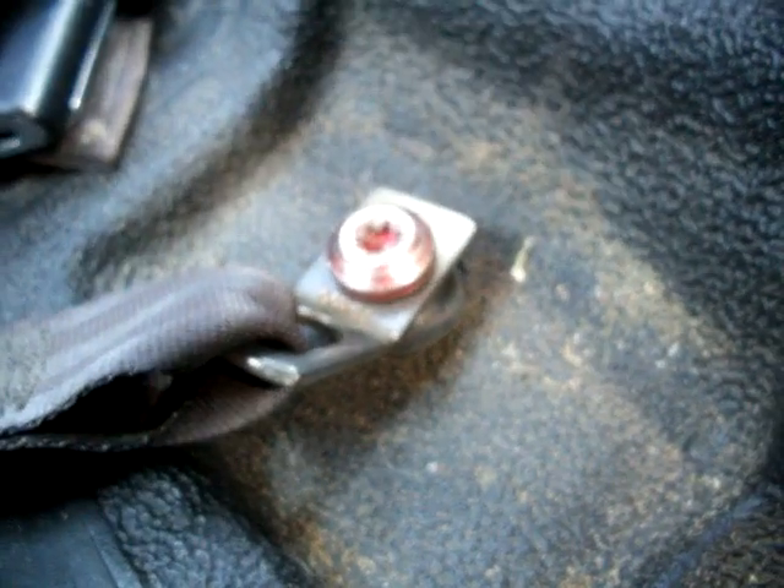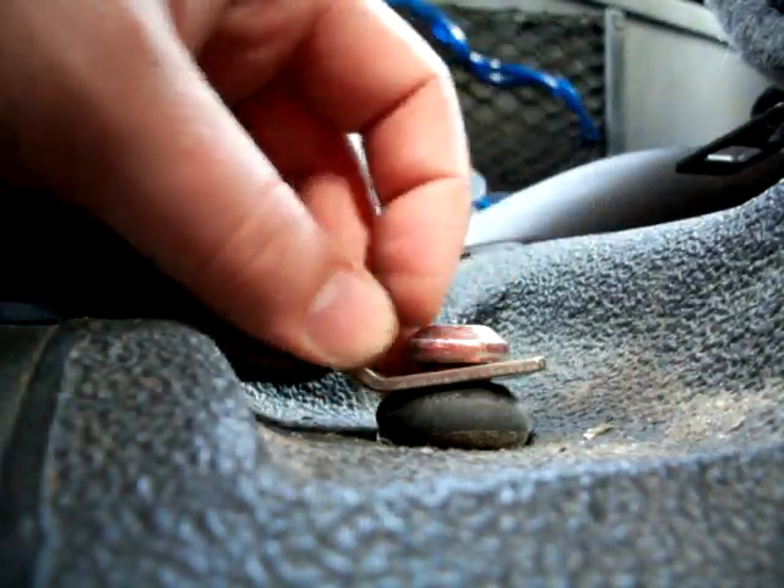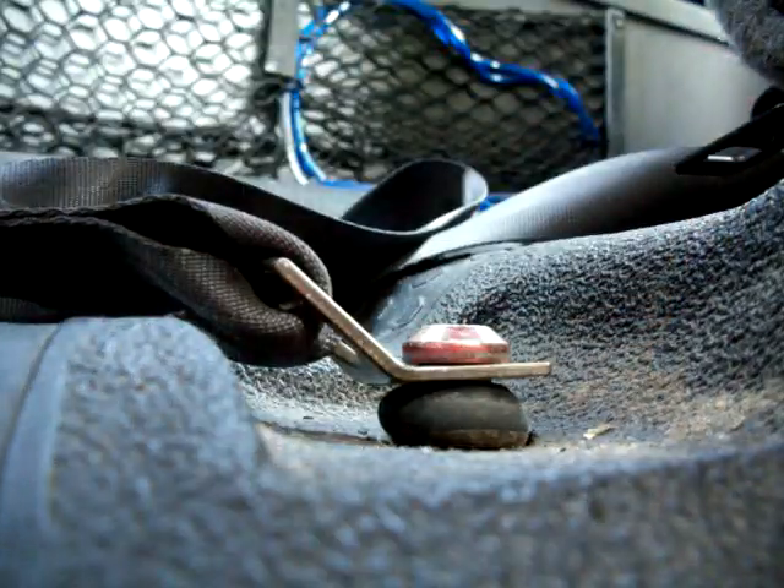I haven't decided how I'm mounting the box yet. Came up with an idea of using these bolts down here, taking the middle seat seatbelts out since I don't carry anybody in the middle seat. I was thinking about taking this piece off and having a 5/16 steel plate welded up that comes out here and mounts to the face of the box. And then having a deadbolt going through the box through the center hump — basically the only way I could take it in and out is with the subs out.